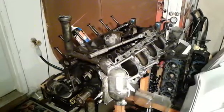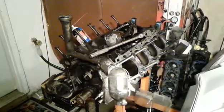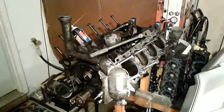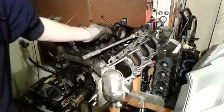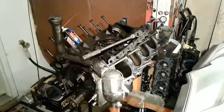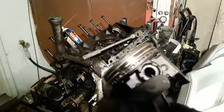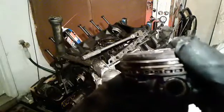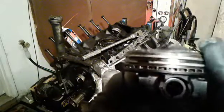I will say, the oil consumption this engine was using was about a quart added every 100 miles. And I don't think this thing was burning as much oil because of dead piston rings. The rings aren't that bad. I think the PCV valve wasn't working properly. I did change the PCV valve when I bought the car, but I never checked to see if it had vacuum. But the piston rings aren't that bad. They're free, they're loose, they're not crimped tight, you know what I mean? The rings aren't the problem.